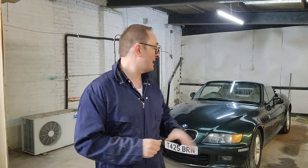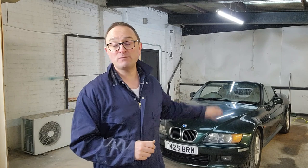So it's got the same gearbox as the other one, I think. So I'm going to pull the gearbox out for that and use that gearbox in order to make up the adapter plate for the new motor. And then I don't have to take the other car off the road while I'm doing it. Got the same, I think, engine mounts in here, which is why I'll mount the new motor off. So I'll be able to mock up the engine mounts in here that connect to the adapter plate and hold the new motor for the other car before I just do the swap over. I'll be able to put the two cars side by side and just do a straight swap.